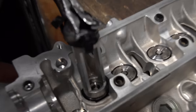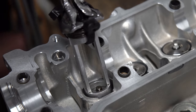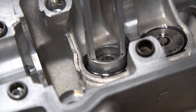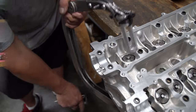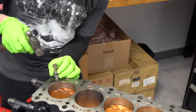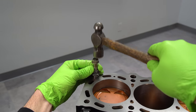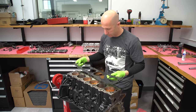This is what they call a valve spring compressor. It reaches around, pushes on the bottom of the valve and the top of the valve spring retainer. Once it compresses it, you can go ahead and put the keepers on. Once the keepers are both installed, you can remove the spring compressor and now the valve spring and everything is all installed. Now we're gonna install the dowels into the block — this is what aligns the cylinder head onto the block and keeps the gasket and everything in line. I don't like to hammer directly onto the dowel because it can bend it, so I made this little tool out of just a bolt and a nut. That stays on the dowel and then I can hammer the bolt — that way it doesn't mushroom the dowel pin at all.